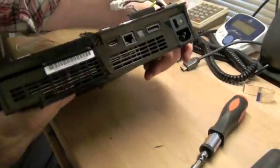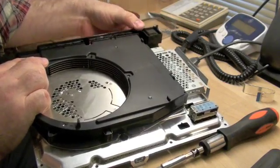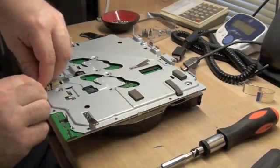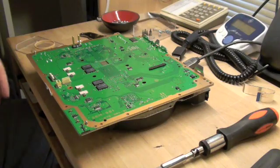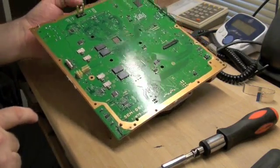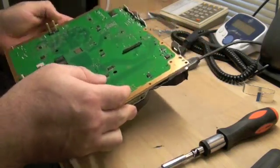You can take this back plate off — see how it's got two clips here? Just carefully pull it straight away and the back will come off. Set that aside before you lift up on this metal piece, because it will lift up. Also, be careful — see these white things? These are thermal pads. You may or may not see all four of them. If any are missing, that means they came off with the metal plate, so just be careful about that.